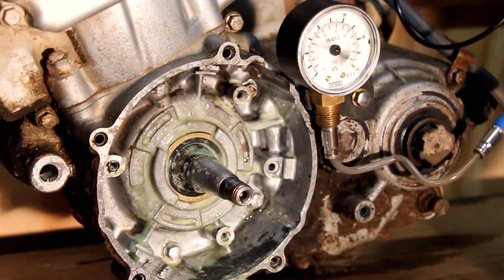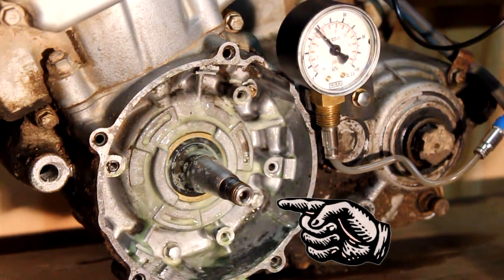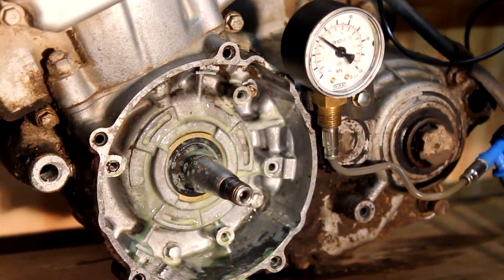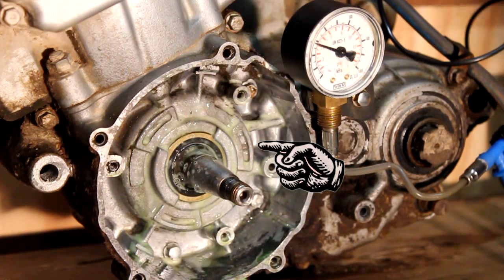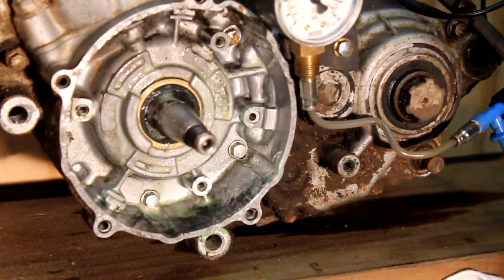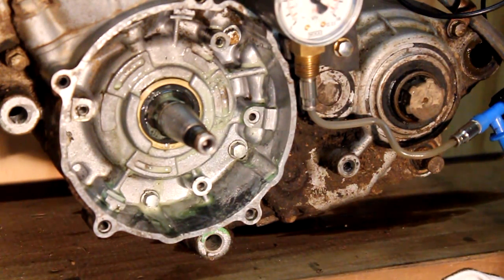You can see the amount of air coming out through where the bolt is. That bolt goes through near the gearbox, so over time you're going to get gearbox oil weeping through and getting into the stator. When I took the cover off there was probably a couple of egg cups full in there, which may or may not have caused the trouble with the stator. I'd actually tightened the bolt up and you can see the amount of air coming through the casting — that's a pretty porous casting.